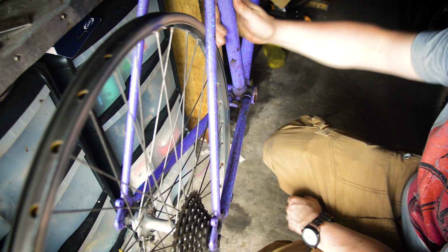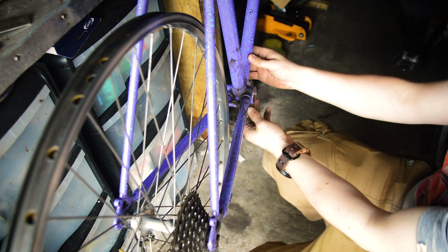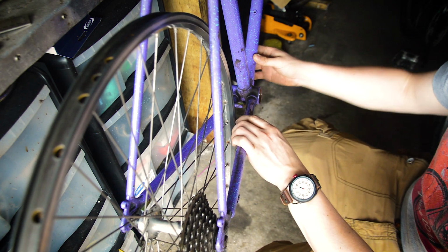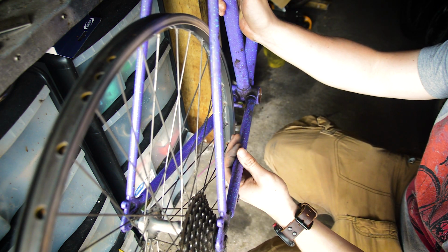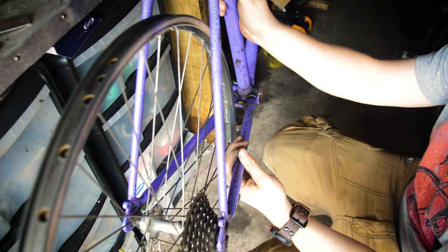But I'll just check for any damage along it. So any deformities in the bike could be weak spots. Again, I don't know its history, so I'm just going to go over it now with a fine tooth comb and see what we could do with it. But okay, video over, I guess. That's just how I personally would go around checking the alignment of a frame to make sure it's square, or to see how badly it's been crashed.